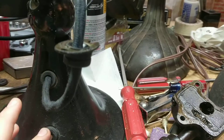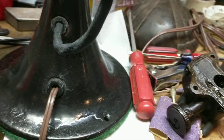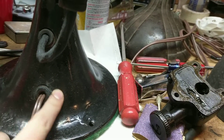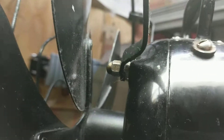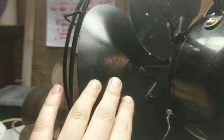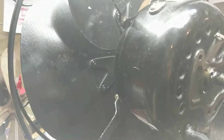I know for sure one of these wires goes to the capacitor, and one goes to the cord — but it doesn't go directly to the cord, it goes to a screw and then to the cord. There are wire nuts there. If the stud comes off, that's okay — just undo the stud. Before you pull the cage off, undo these and be careful not to bend anything, especially not the blade, because these are really hard to balance.